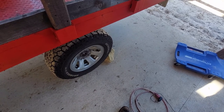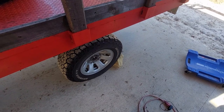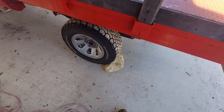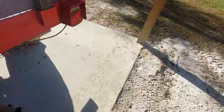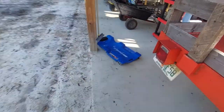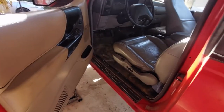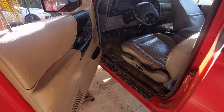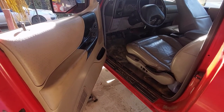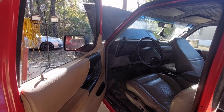I realized I need to take the truck out of gear and put it in neutral so I don't have to fool with the clutch while focusing on the steering. I've come up with some improvised wheel chocks — I have a lot of limestone in my yard. I've already made a small adjustment. The way it works: for the center hex, you turn it to the right to bring the worm gear closer to the other gears, and turn it to the left to loosen things up.